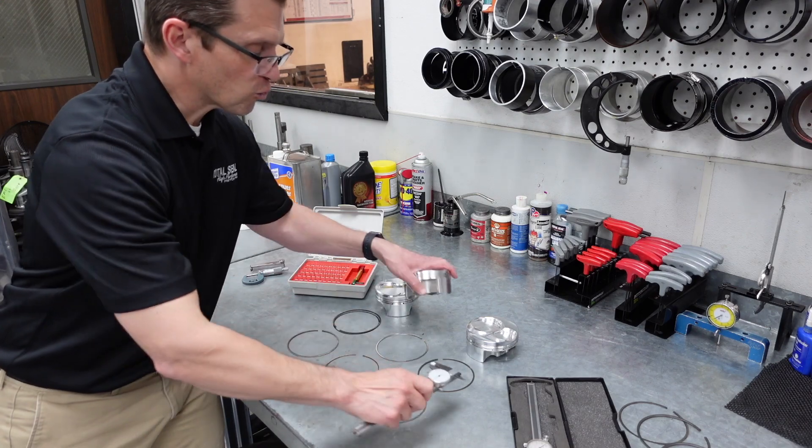Those are the two really critical dimensions of the piston ring groove: the depth and the height. To get the best ring seal, you need the best ring fitment. You want the right fitment, the right back clearance, the right vertical clearance for your piston — the ring's got to fit correctly. If it doesn't fit that depth correctly, it can cause all kinds of bad things. Proper clearance equals proper fitment equals proper performance. And that's your speed shop tip. Thanks for watching.